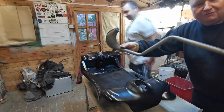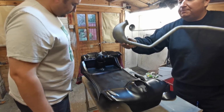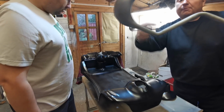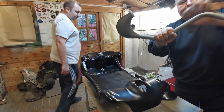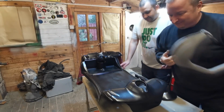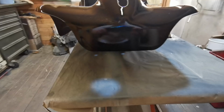Look, I just thought I'd show you, because you aren't going to see this in my videos. That's the exhaust pipe off the Mini Moto, and I've sandblasted it, so I'm going to paint that in heat resistant paint and probably wrap it with exhaust wrap, because that comes up by the carburettor. But I thought I'd show you that, give you some proper interest in the videos rather than this old tat. Right then, let's get this third coat on.